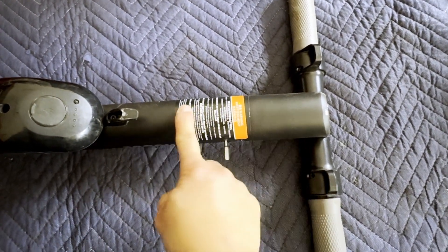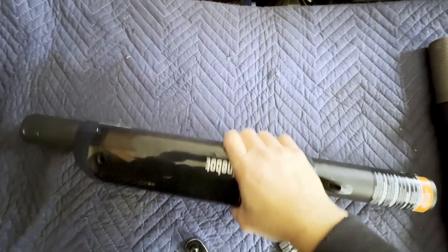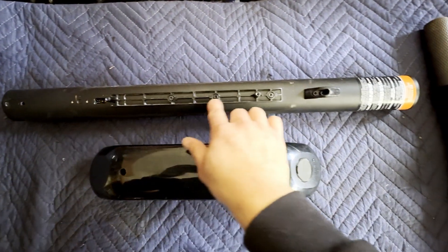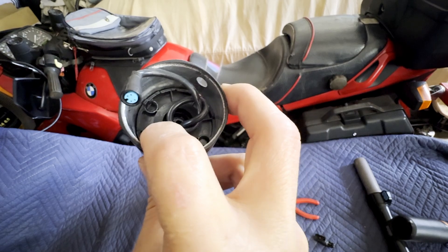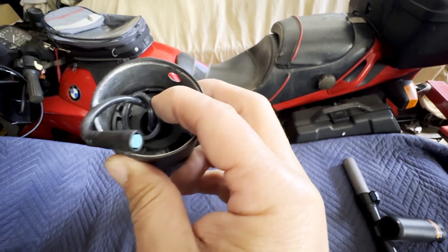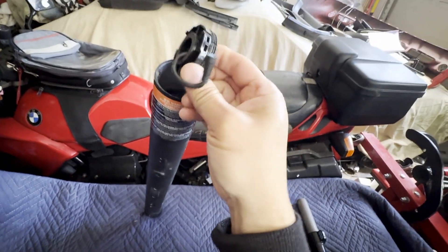There are some more wires inside the handlebar here. So let's go ahead and remove the two hex keys on each side of this and open up the wires there and see what we've got. Mine came with this extended battery pack, so you need to remove that in order to get the internal battery out from this tube. It's also just a couple of hex screws, so just pull those off. Once that's off, you want to remove all the rest of the hex screws and then a couple more steps and we can take everything out of the tube. Then there are those two slots on each side — I just used a pair of needle nose pliers and you just kind of turn it counterclockwise a quarter of a turn, and then you want to uncoil this wire. You can see how they've got it in a little knot here so it doesn't accidentally feed itself down through that rubber gasket, so you want to undo that so you can feed the wire through.